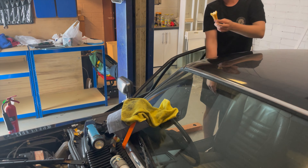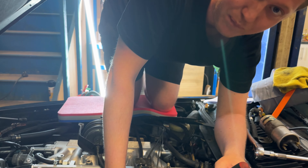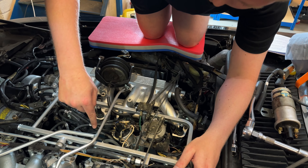So it's running, but it's not firing. I figured that the timing's out. But we're kind of doing everything opposite — instead of starting at cylinder one A here and working our way around the distributor, we're starting it from here.